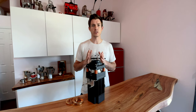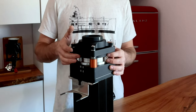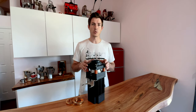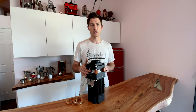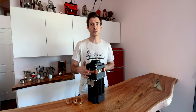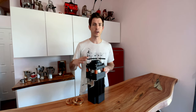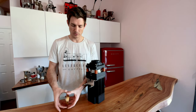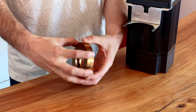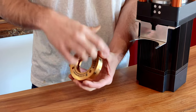Vertical alignment means that the two burr surfaces are as parallel to each other as possible. In this setup we have a rotating lower burr and a static or stationary upper burr. Our goal with this grinder, and really with any high-end grinder, is to design it in a way that allows us to get the lower and upper burrs as parallel as we possibly can — meaning at any point in the rotation we are getting as close to the exact same distance between the burrs from the front to the sides to the back, all the way around 360 degrees. With a clamping mechanism that centers the burr with three points, we make sure it's exactly the same all the way around.